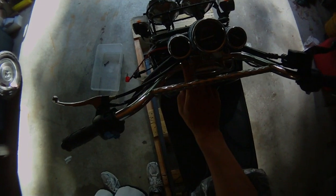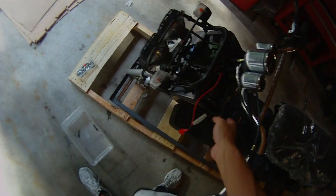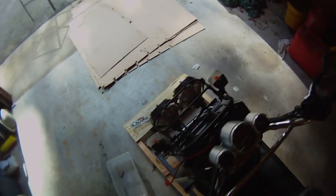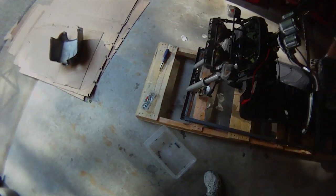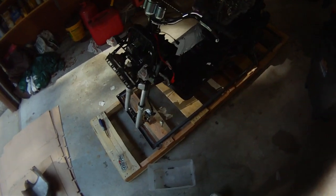You can see the bolts — I've done two so far and I'll do the next couple. We're also going to be putting the battery in, which goes into this compartment, so we're going to open that up. There are some hinges down here — screw here, screw here, two screws on the top, two screws on the side. Take those out. Then we'll get the battery installed. Make sure you put your acid in and let it charge up for a good amount of time before you install the battery.